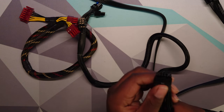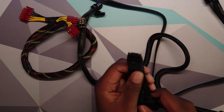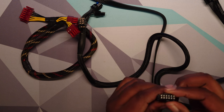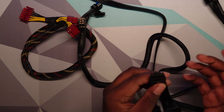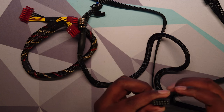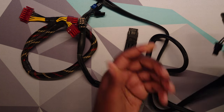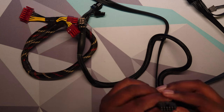This is based on 18-wire gauge because there's no spec for 16-wire gauge. I think this is why it looks very rushed — the spec doesn't even say Molex connector. It just shows a drawing, and that drawing doesn't show the inside part, which is the most vital part that makes the connection. There's quite some difference for the inside part — materials, making sure you get a very good connection. With more exotic materials you make a better connection, but the more current you pass through these connectors, if you lose even a slight bit of contact, you're going to have a lot more resistance and that will heat up the connector a lot more. So if the 8-pin is slightly out of spec, you'd still be fine — but for the 12-pin in the same situation, you would not be fine.